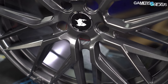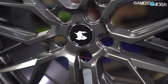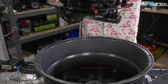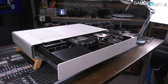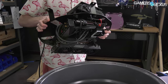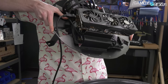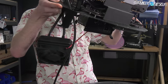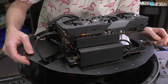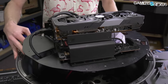Let's get into Patrick's build notes for the case. We'll talk thermals, because this is not a good one for thermals. Then we'll go through the conclusion of whether it's worth it. This is the most difficult to build in case we've ever reviewed, including all of the small form factor ones like the Cryorig Taku, which was like building inside of an IKEA shelf. Assembling the test system took an entire seven hours off and on, and we'll dig into the reasons why. This case is only meant for water cooling, open loop — and even that doesn't really work. Don't buy this case with the intention of using an air cooler or a CLC on either the GPU or the CPU. Don't even try it.